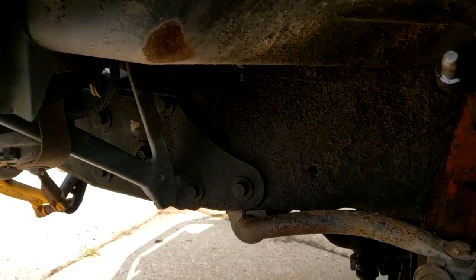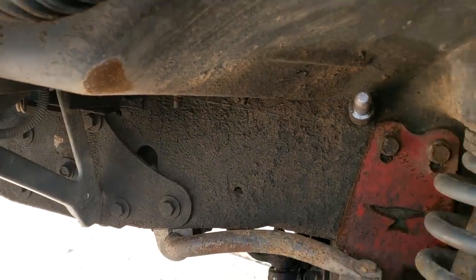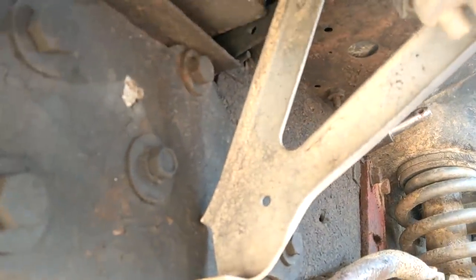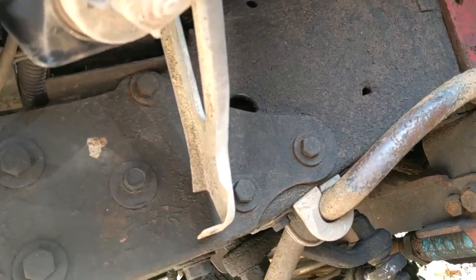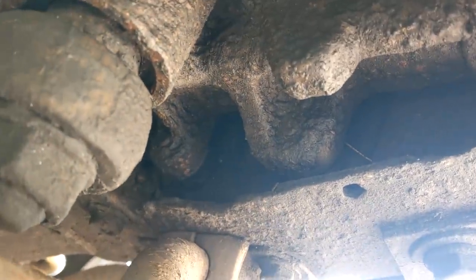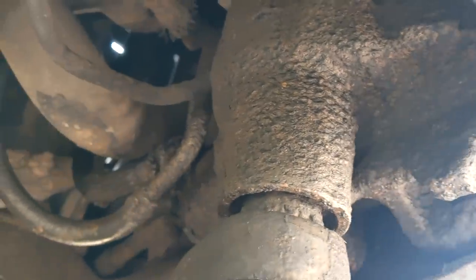To get this box out, we've got three steering box bolts over here. Those are things you want to make sure are tight. Make sure you've got tight bolts and make sure you don't have a cracked frame. My front bumper actually wraps around all three bolts, so I have not had frame crack issues. I've also got a beefy spacer, and we've got a heavy-duty spacer and all that crap, so it's definitely box stuff.